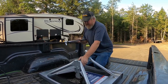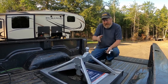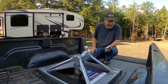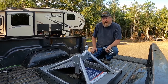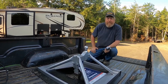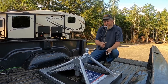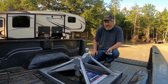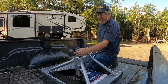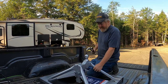That's exactly how long it takes to put in the Anderson Hitch Ultimate Fifth Wheel Connection hitch. So far we really like it — we'll tell you better after our first camping trip. We're going to put roughly 2,400 miles on it in the next few weeks. We'll carry our torque wrench with us and check this periodically. You do have to back these jam nuts off before you check the main bolt, because if they're tight that gives you a false sense of torque.